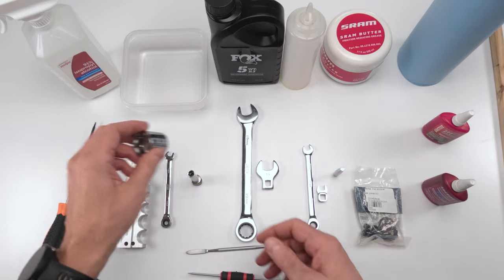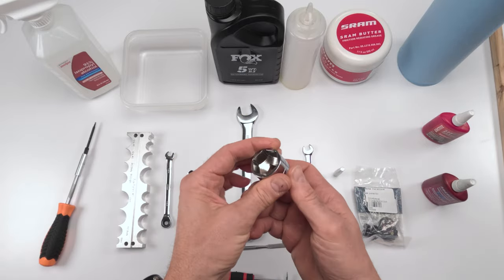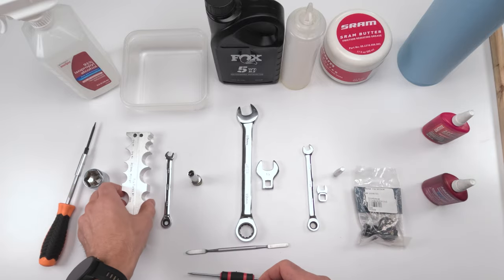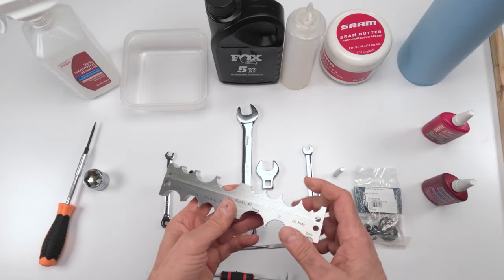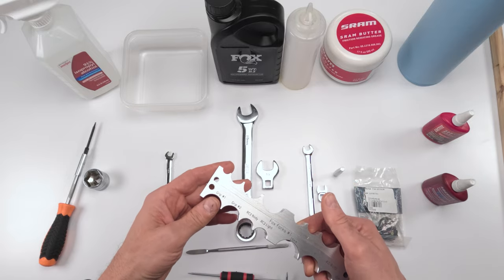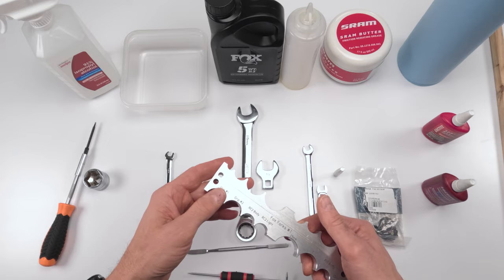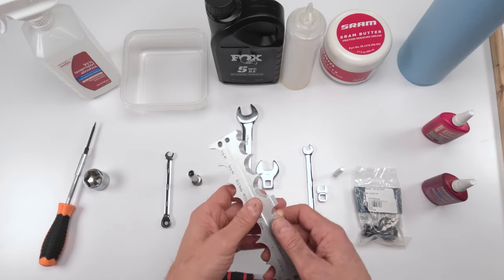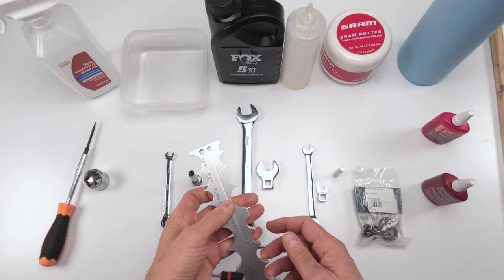So we're going to need a 26mm chamferless socket again in order to remove the damper itself from the upper body, right? Now you will need a vise for this for sure, and you will need soft jaws. I don't remember which size, we'll figure that one out. I'm pretty sure I'm going to need the grip. In fact, I know I'm going to need the grip on this side, but I forgot. I think it's the 9mm that we will be needing